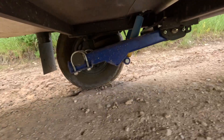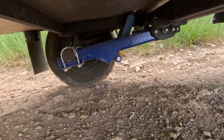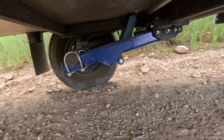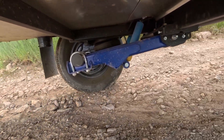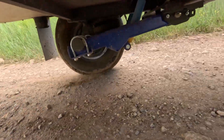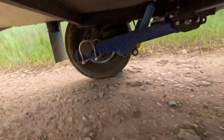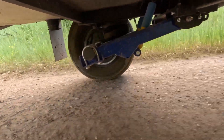Five — there you go, five's not locking up. I'm going all the way engaged and it's slowly trying to stop, coming to a complete stop. Really good brakes. I'm surprised how well they lock up because some trailers you've got to stick them on 10 to get them to lock up — this is locking up at six.